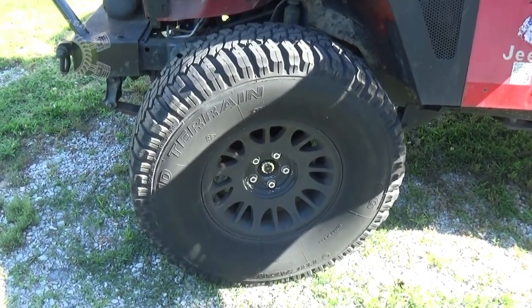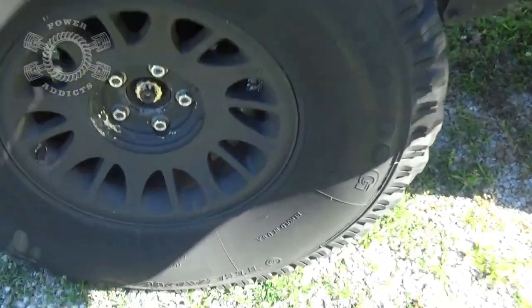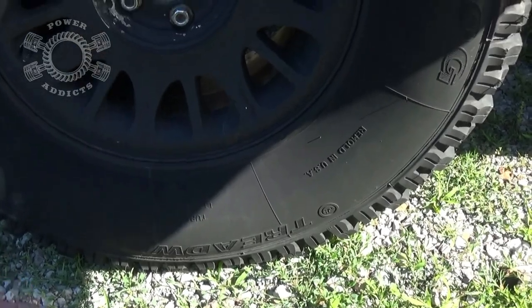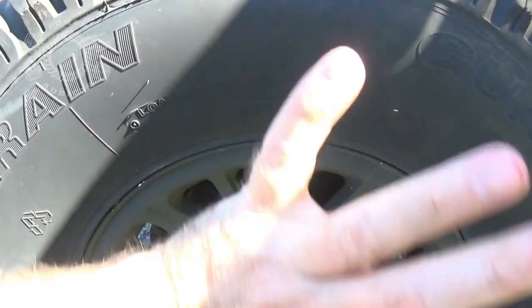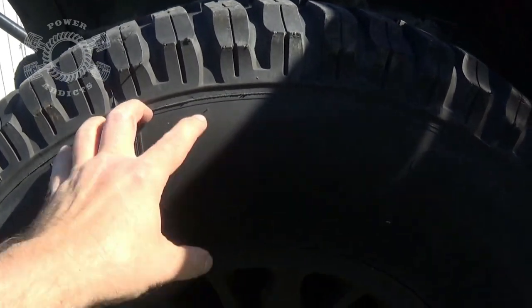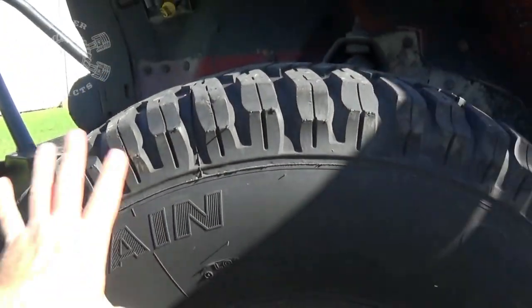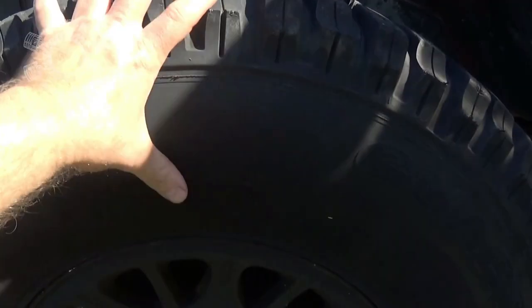Now, I'm sure down in the comments, somebody's going to ask, hey, man, what kind of tires are those? Those are Tread Rights. Tread Rights is that company that does what some people call retreads. They're not retreads. They're remolds. And what they'll do is strip all, like this, say for instance, the carcass of this right here, the inside belt, stuff like that. And just say the carcass was a BF Goodrich, for instance. They'll strip all the sides, the tread here. They'll mill it all off, put it in the machine and spin it, mill it, get all the old rubber off.